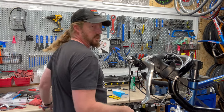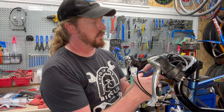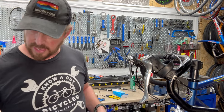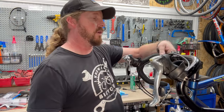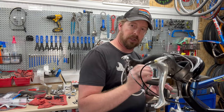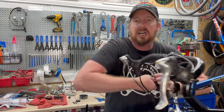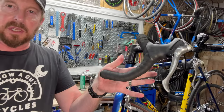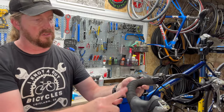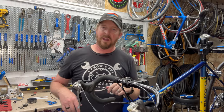Once you're at that point, cut on the down side about an inch down. Save that excess for later. Do another pointy end cut like so — that way there's nothing that kind of catches or flicks up. Then wrap it underneath like so, nice and clean. Roll your bar, cover back over, and last but not least, put your end cap over the end, holding that excess over. Nicely wrapped and even all the way around, a little extra overlap on top with that extra piece of housing on the backside — you don't even really notice it. It kind of just blends in and gives you that extra comfort and cush. Wrapping 101.